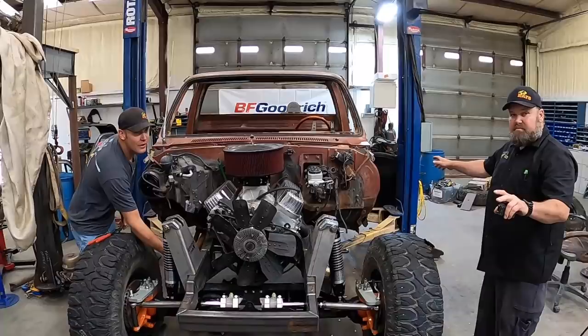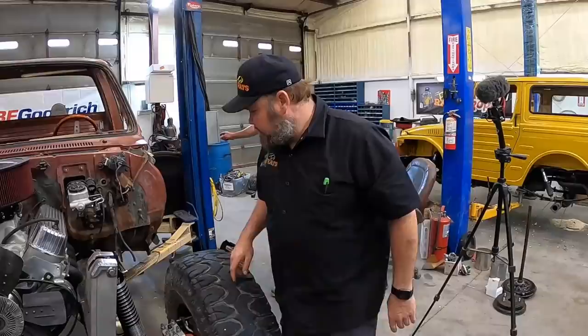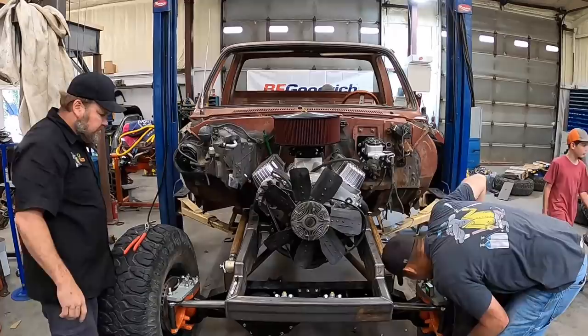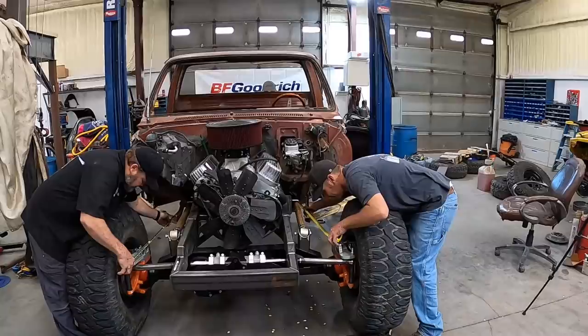Don't move it — square, don't move it. Grab that angle finder. Let's see what the old caster looks like. Yeah, two — three. It's got to roll a long ways backward, so watch that. I just set it on the ground for a minute — that's pretty close to ride height right there. Okay, right there — that's pretty good, 6.2 degrees. I can do all that — it'll track down the road with that.